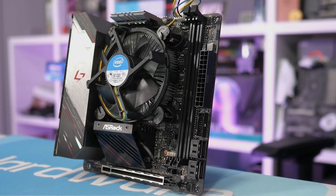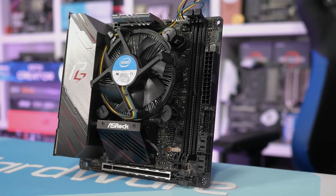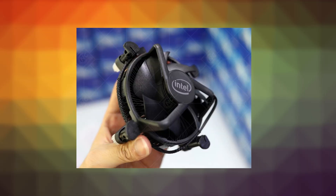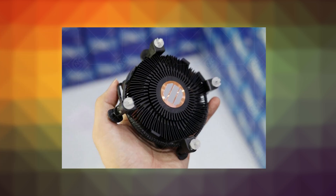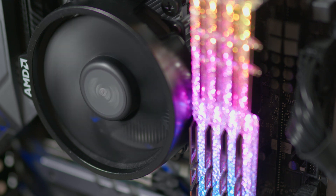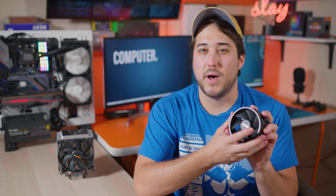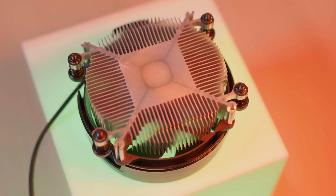Clip on that fan and plug her in. And real quick — if you have an Intel stock cooler, replace it now. Get rid of it. It's terrible, it looks horrible, and you deserve better. I don't care if they updated it recently — it still looks terrible. Don't put it on an i9 or a new i7, because your computer is going to run incredibly hot. But AMD includes an actually usable cooler, which is really nice to have, especially for those that don't want the extra hassle and just want it all in one package. It's not only surprising that it works pretty well, but even these lower-end models actually look pretty solid.